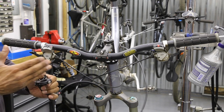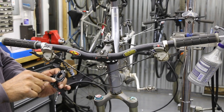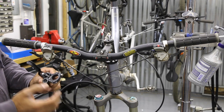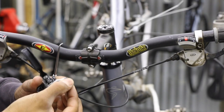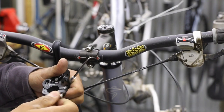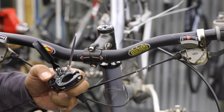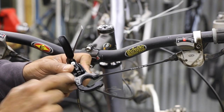These Shimano brakes have a nice safety system — you can take the bolt out and there's a hinge so the clamp will open, but the clamp won't open until you hit a little button. You have to push and hold it while you open the lever. That's part of their safety system: if you did lose a bolt it'll get loose but it won't fall off your bike unless you push that button, which you're unlikely to do while riding. We're going to take this bolt off using a four-millimeter — they've kept the standard for brake clamps and bar sizes.